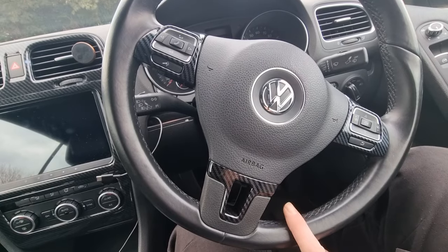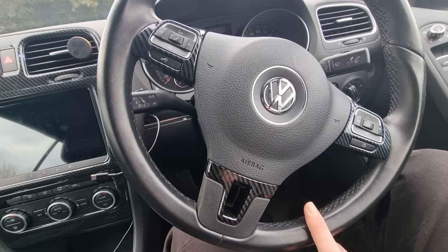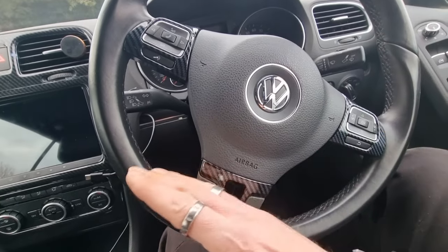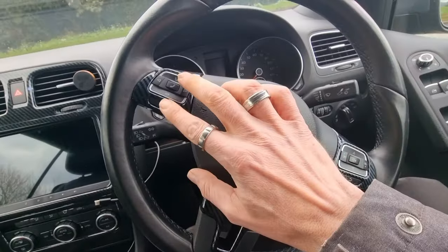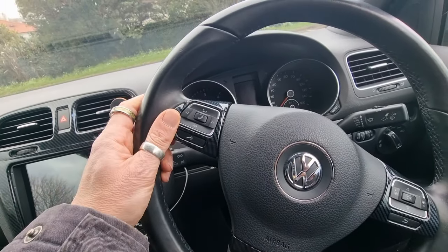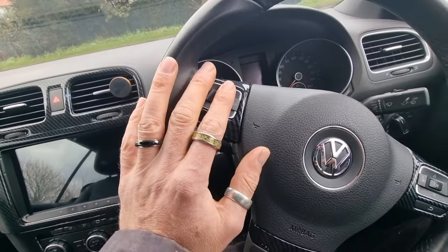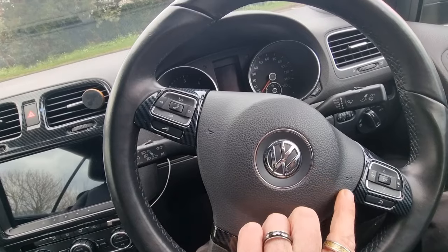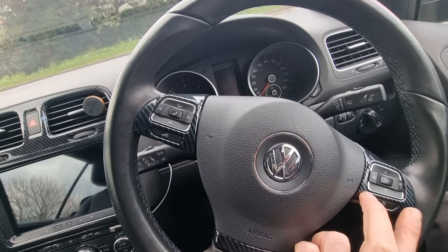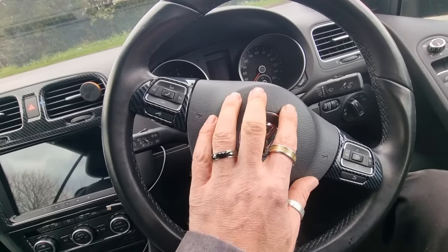Something else I'm thinking about: upgrading the steering wheel. I've been looking around and I think the Polo — is it C6 or 6C? — has a slightly different layout of buttons, it's got a flat bottom. Slightly different layout but it has the same buttons. You can get some that have cruise control on the steering wheel on the later ones, but some of the earlier C6 Polos don't have it — you've got it on the end of the stalk, like I've got. So I don't think any coding would be needed because all the buttons are the same.